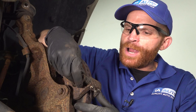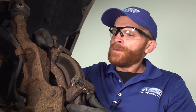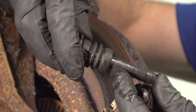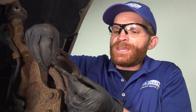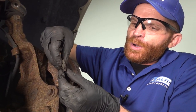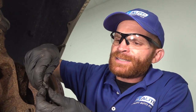To check the slider pins, I always like to grab onto them and give them a wiggle — sometimes they move freely, other times they don't want to move at all. Go ahead and slide it right out of there, give the pin a quick inspection, and make sure it's not rusted, rotten, or damaged in any way. Then slide the boot right off to give that a close inspection as well. The boot is supposed to protect the pin from moisture and debris — squish it around and make sure there's no tear in it anywhere.